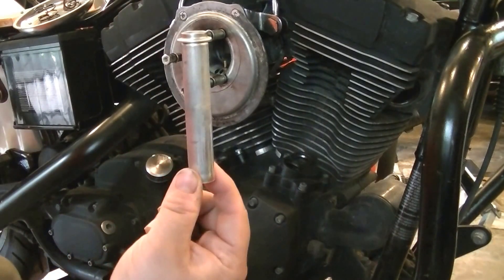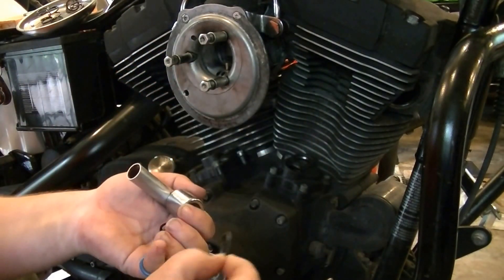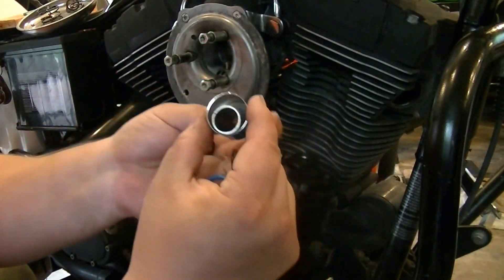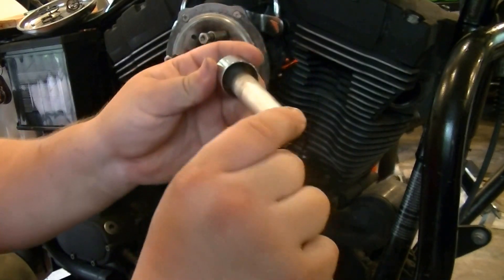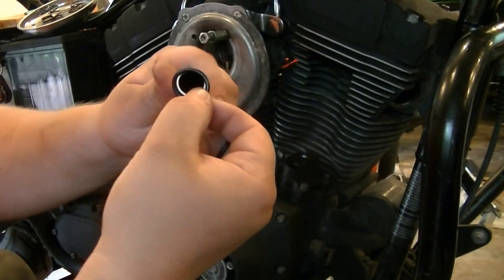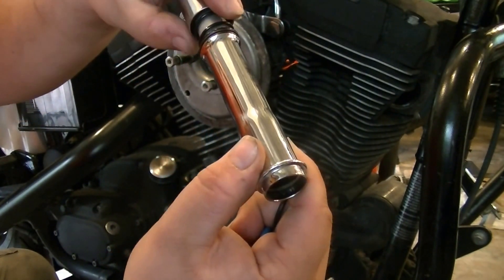First you're going to reassemble your upper tube. You've actually got three O-rings per tube. The biggest O-ring goes on the bottom of your new tube. The smallest O-ring goes in the center. The other O-ring — about the same diameter but fatter than the smaller one — goes on the top of your tube. Take the collar and your upper tube, put the collar in with the open end — not the flanged end — facing down. The flanged end goes up. Take your spring, slide your spring on, get your washer, slide it on next, and then your smallest O-ring goes over that. This all comes together and that O-ring seats up against there with the spring.